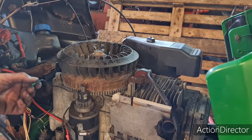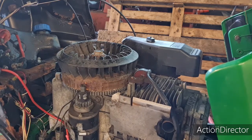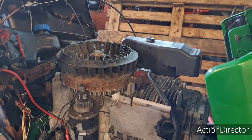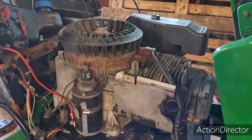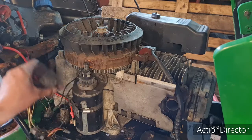The only wires we need is this one — we need the kill wire and two wires for the generator, and that is it; that is all these engines need. This hasn't got the fuel shut-off on the bottom of the carb. Somebody has messed around with the wiring on this and that's why that wire got trapped in there. That jubilee clip isn't factory either — what holds this solenoid. Something's gone awry. The regulator was bolted on there but it shouldn't be — it should be bolted somewhere else, probably on the engine cover.